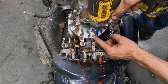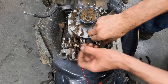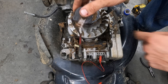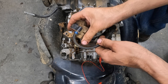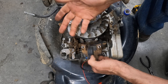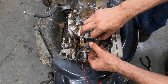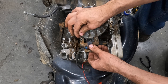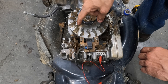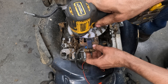We're going to take a 5/16 to remove the coil. I don't advise tightening with an impact — just use it to remove and take the slack out of the bolts. Pull off the old ignition module. Remember how the wiring was routed. I have another one here, so we're going to plug up our ground wire. This would obviously be a new or a good used coil. You need to set the proper air gap — that's the space between the coil and the flywheel. Since the flywheel is rotating, you have to have proper distance or it's going to rub.